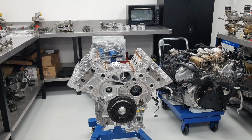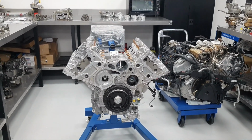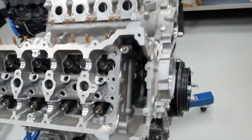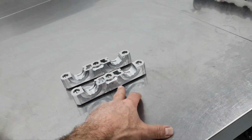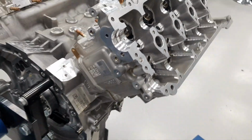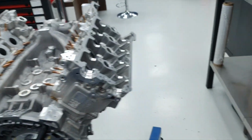Today it's Tuesday. Is it? Yes, it's Tuesday, January 14, 2025. Alright, and before I close completely the engine, let's turn on the camera to see where I am. I have torqued down both cylinder heads. Alright, bank 1, bank 2, in place. Everything's been torqued down. Three times 90 degrees. Alright. Then I have hydraulic lifters here. I have the bridge that comes here. Classic. This is married to the cylinder head. 19888 left. And you have to double check the number here. 19888 left and right. Alright.